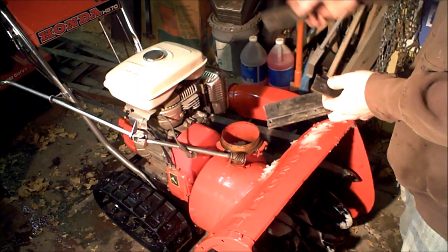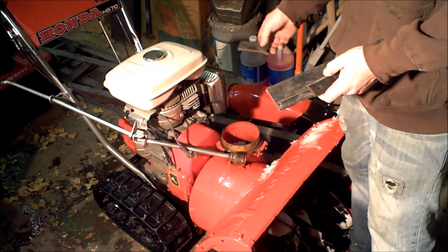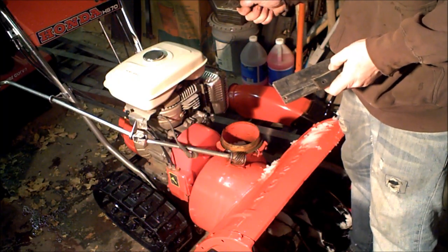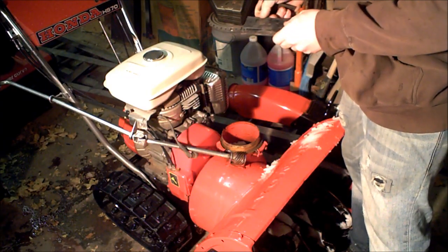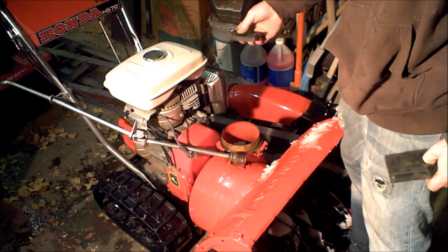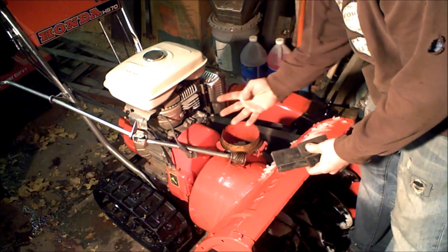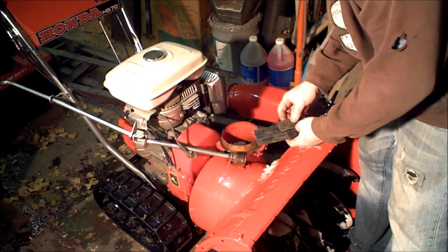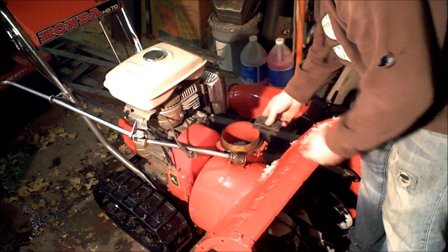I also have some shorter ones from other snowblowers. This impeller has four blades. What I do is mount a rubber piece to each blade. As this goes around, since it's rubber, it can actually touch the edge. They actually wear out with a nice chamfer. I like to leave it against the housing so it wears out quicker and makes itself exactly to the edge — that will clean it all the way around. You don't need to install it on all four; I usually just install it on two and that is ample.